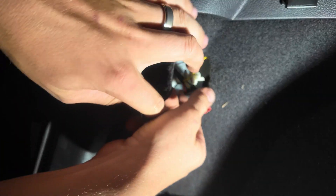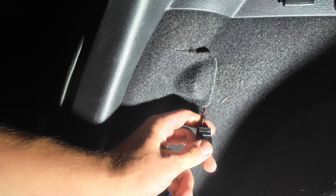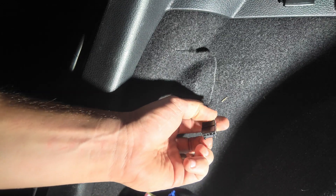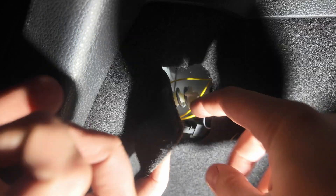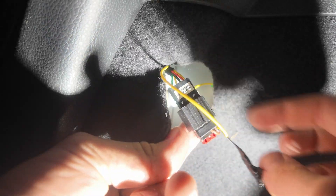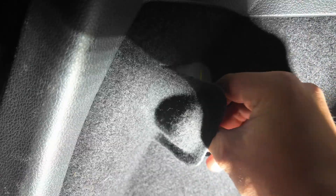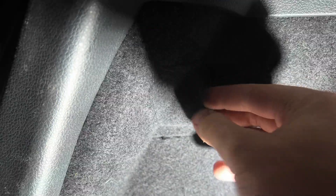Starting with the left side outer harness — it's pretty simple. Disconnect the taillight from the OEM connector. Then we need to disconnect one pin: just pull out the gray wire, leave the other two where they are, insulate the gray wire, and push it back in.